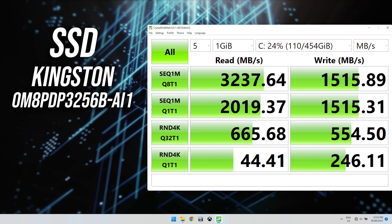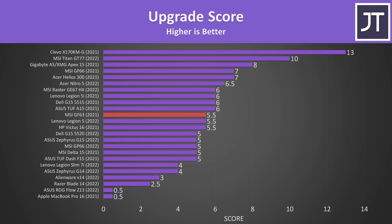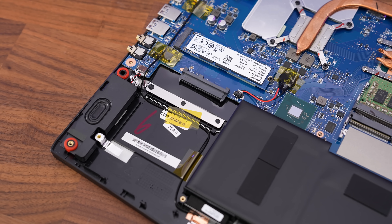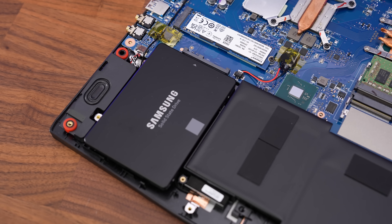The installed 512GB SSD was doing quite well for the reads and half as high for the writes — this still seems pretty good from a cheaper gaming laptop. The upgradeability score wasn't too bad, but I took off half a point from ease of access due to the difficulties I had in opening it. Otherwise, despite only having one M.2 SSD slot, we've still got the option of putting in a cheaper 2.5 inch SSD, or a hard drive if you really like pain.